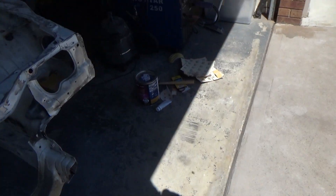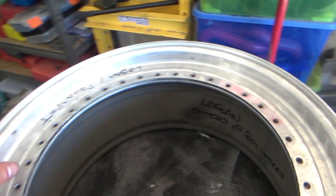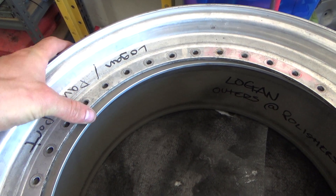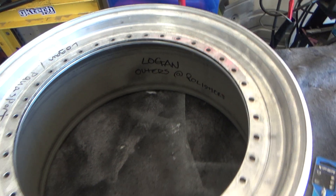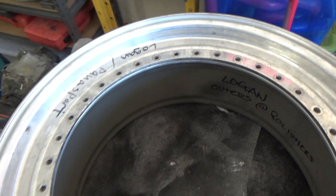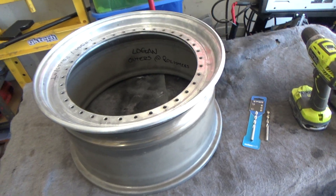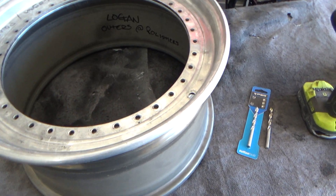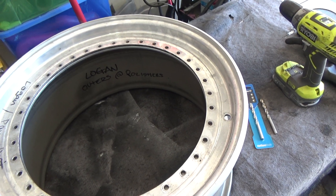Start drilling some holes and see how we go - lines up perfectly. Center the lip first, then the barrel. Gonna clamp them in place, run the drill bit through all the holes. Shouldn't take too long, hopefully. Repeat that six times. Think the worst bit is going to be drilling the valve hole, but bring it on.